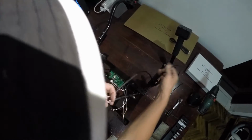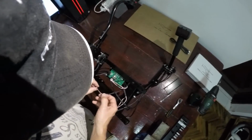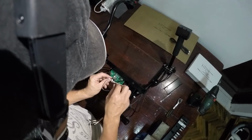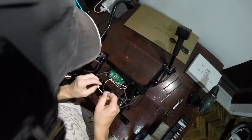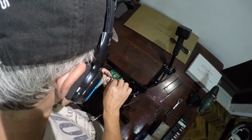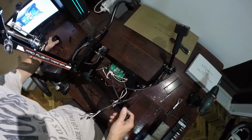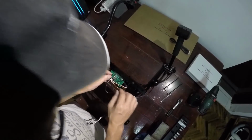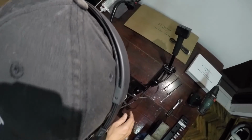So there must be number 3 coming from the collective somewhere. 5, that's throttle. There you go, number 3 for collective axis. Then number 4 from pedals. Black on the way down, very important. Number 5, I think what will happen if you have the black and white reversed, the axis will still work till it will be reversed in Windows or any other thing. All right, number 9 is coming here, and there you have it: black, red, white. So black, red, white. Number 9.